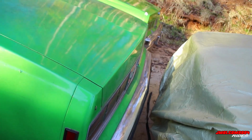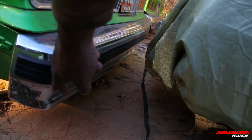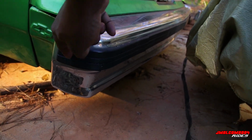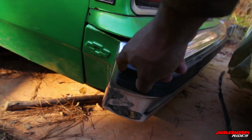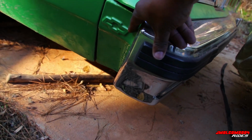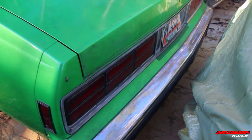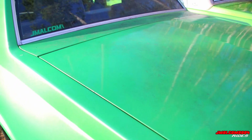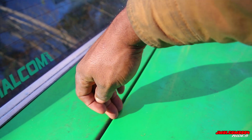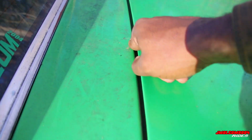So if you're a perfectionist, know how much this costs, cause some of these cars come with this bumper with this one piece impact strip, and man, they hell to find, and when you do, they high, cause people know what it is. So you want to check that. You want to check the bumper filler. All of that. Open your trunk. Check your trunk. Check up in here for water, cause sometimes water goes down through here, collects, and it'll rust. It'll rust all up in here.